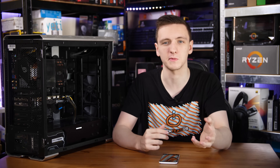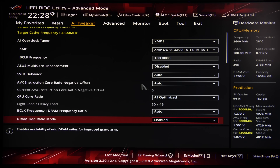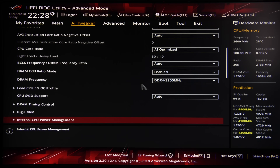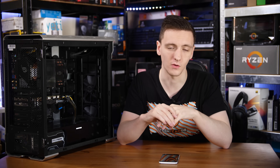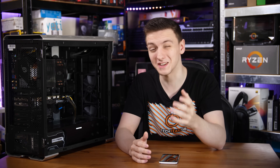There's also a cooler point score that rates how well your cooler can cool the CPU — something the motherboard learns over time as you load up the CPU. A better cooler gives a better score, which means the system can auto-overclock further. You do have to manually set it to 'AI Optimized' in the overclocking settings, and then it handles everything for you. It's actually a pretty good and stable overall setup.